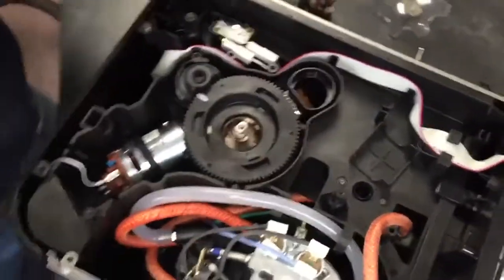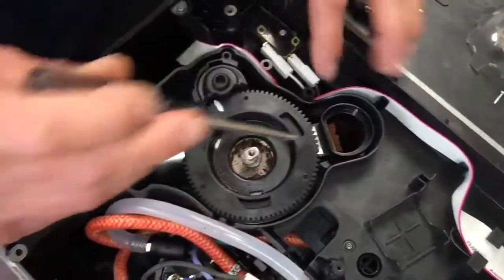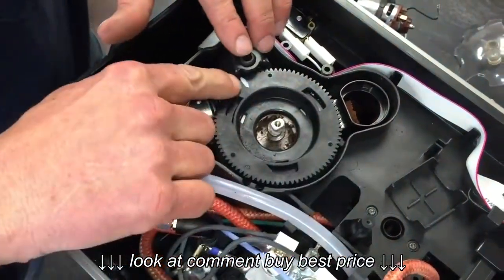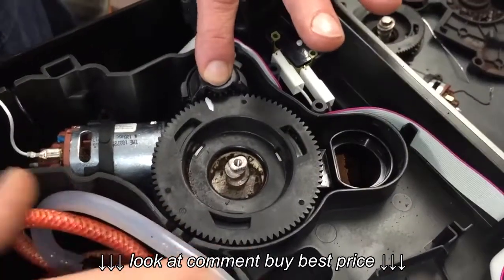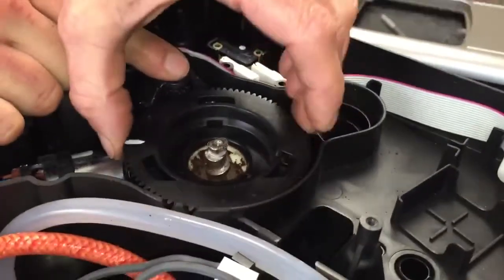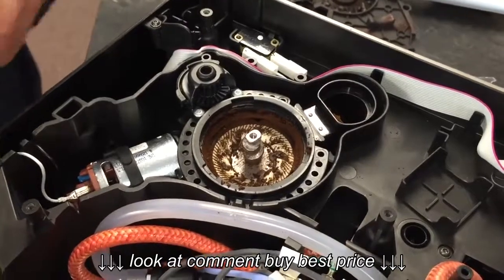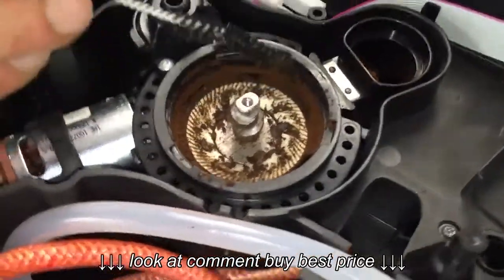Now look inside. If you find that this whole area here is full of coffee — just packed in here — odds are this chute here is broken; we'll get into that later. Let's assume for right now that the chute's fine and you just want to take this apart and clean it. Notice this white line here — that's going to be facing over here when we're done. We have to take off the upper burr plate. You push down on this, then twist it — it goes way down like that. Turn it until it stops, then it pulls right out. This is from just normal use; this is not a clogged grinder. If you use an oily bean, it may tend to get plugged up more.